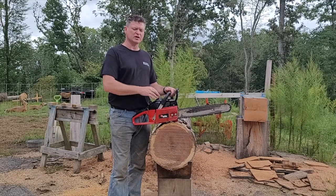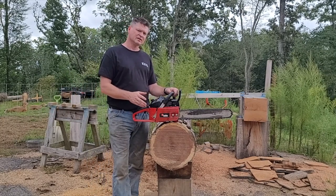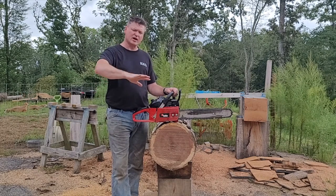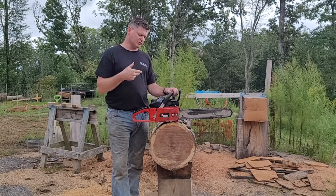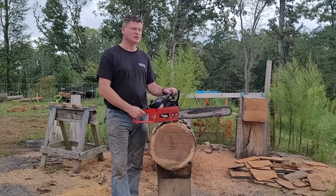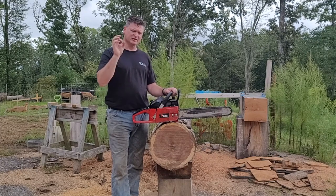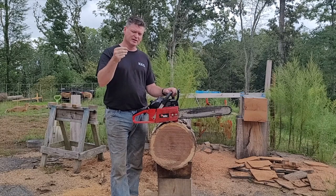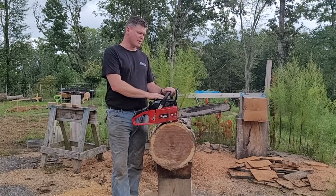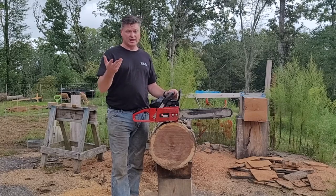I thought I had spark issues, but every time I let it sit, like it's ran, it'll run good, right? But then I let it sit and it wants to flood out on me, it seems. All the vents and everything like that are good. I think the carburetor might have been leaking through the Welch plug. That's what somebody suggested to me, so I just covered it with JB Weld. This also has a little accelerator pump with a little spring-loaded BB in there. I pushed on that a little bit and maybe it cleaned it out a little bit. I'm not sure. We'll have to let this sit now for about 15 or 20 minutes and see if it restarts without any issues before I claim that I fixed it.